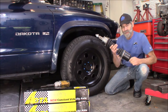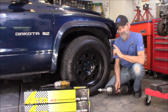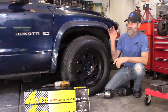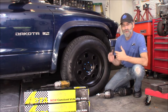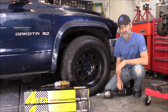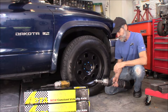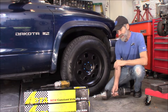I got the set of new axle shafts. I just recently noticed that the axle boots were leaking and it did not take long. I drove it just down the street and you can hear the click, click of the CVs in here. So they dried up — it's just my outer boot that's leaking, but we're going to replace these shafts. I'm sure they're originals, and get this thing dialed in.